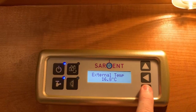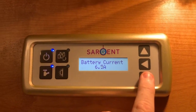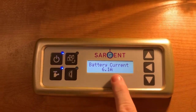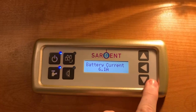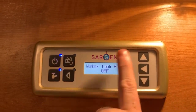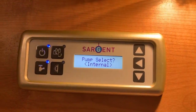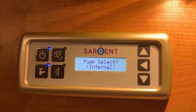The next screen is our external temperature, and then we have the battery ammeter showing us the amount of current going in or out of the battery — currently 6.2 amps going in because we are charging. If we were draining, this would be a negative number. Then we have pump select, and this option alongside the next screen down work together to choose how our water system is going to work.